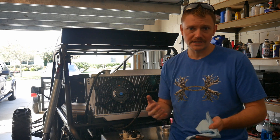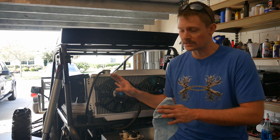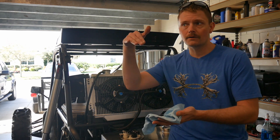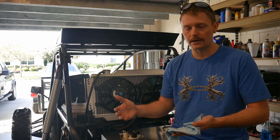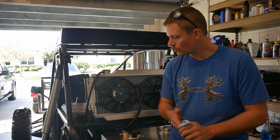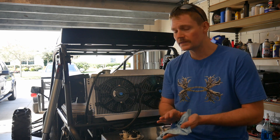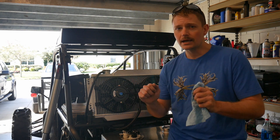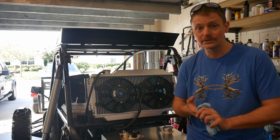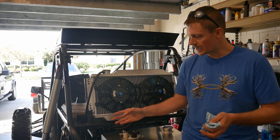I don't want it to compress through the full 16 inches, because if it did — or if I left it the way it was previously — if I get any air on the return, I would just blow through all of my suspension and bottom the rear end of the buggy out. I don't want to do that. So I want basically built-in bump stops. By adding the additional oil, they should stop prior to bottoming out. Also, that allows me to run a little bit higher pressure than normal to get a sportier feel. Because we're using the straps, I really don't have a lot of built-in sag, which I'm okay with. It's not going to be quite as plush as if I had more sag built in.